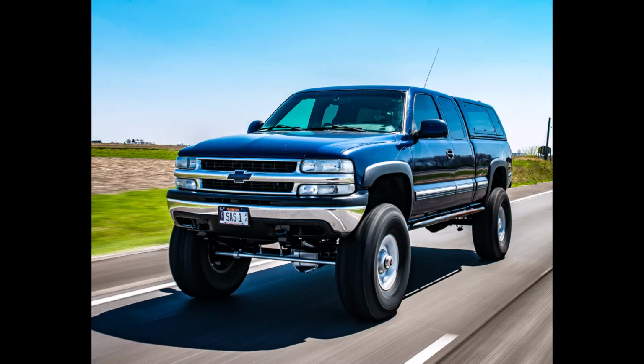It's funny because I got rid of that shaved 14 because it was foaming the fluid. I thought it was overheating, but it wasn't. There's a TSB out there for 14 bolts from older body styles that you need to move the breather from the chunk to the axle tube. I did it right before I swapped in my GMT 800 14 bolt, and it fixed it. So it's already fixed.